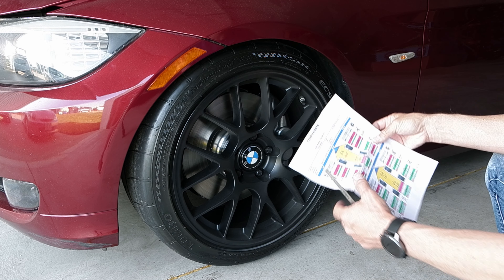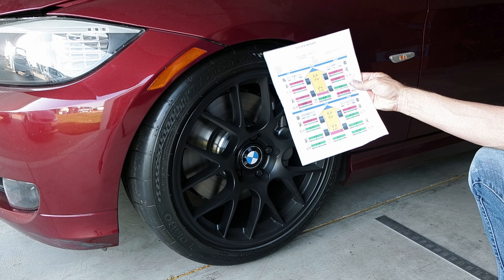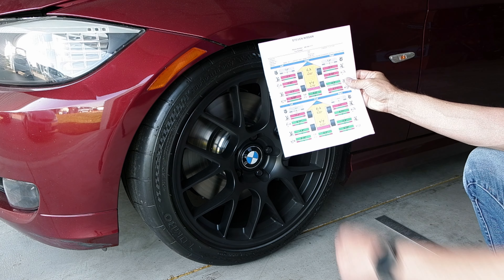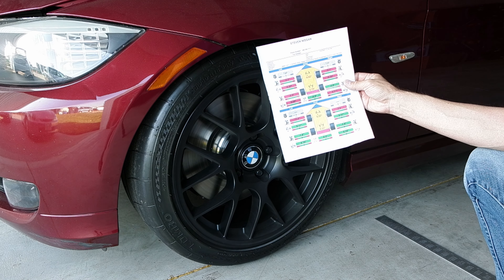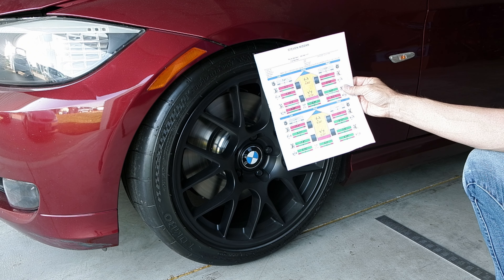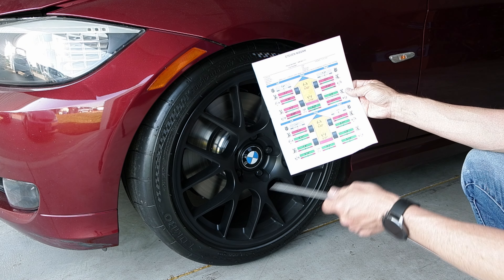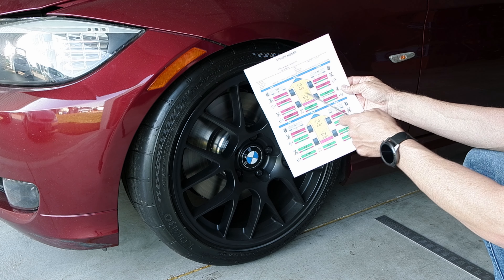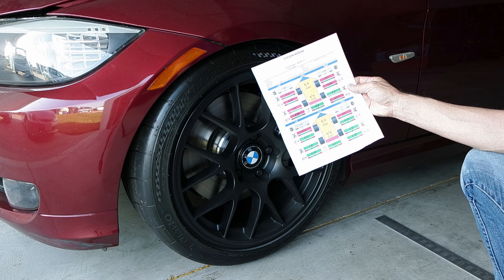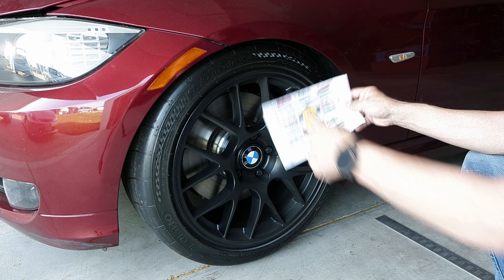Now for the numbers — here's the printout of the alignment. The upper part is a lot out of whack, which is kind of expected since I took everything apart and replaced a bunch of things. In the front and rear, most of the suspension was reworked on this car, and I eyeballed the alignment myself. The front negative camber was at minus 2.3 on the left and minus 2.7 on the right, which is quite a difference.